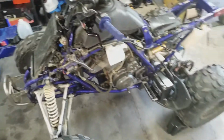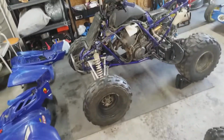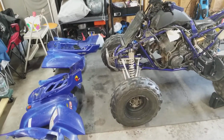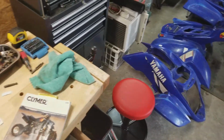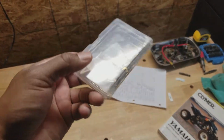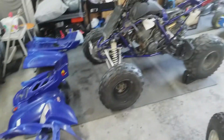I bought a carburetor repair kit. You know, the new needles. I said I was gonna buy a new carburetor, but I didn't. I just went on ahead and bought the cleaner and the kit to go with it. All I did was clean it out real good and change out a few jets in it, replaced a few O-rings, and you know, basic stuff.